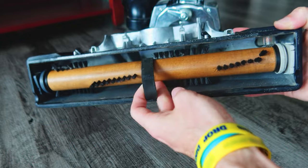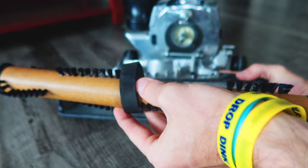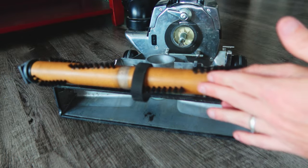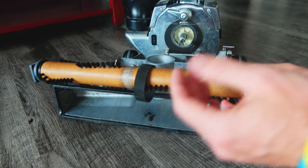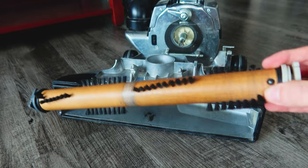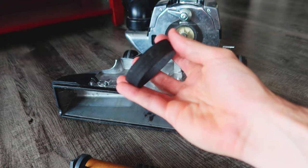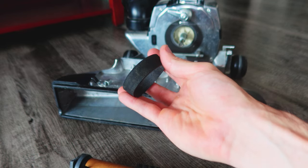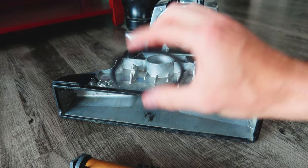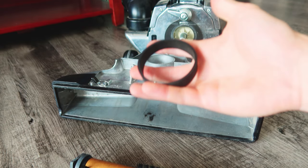Then you're going to either pull on the old belt or grab the wooden spindle and pull it towards you to release it from the vacuum head. Now is a good time to grab some scissors to clean the spindle off if you have hair, threads, or ropes stuck to it, and then pull your old belt off of the spindle. Once the spindle is clean, grab a new belt — part number Kirby 301-291. I got mine off Amazon in a pack of six for about seven dollars, and I highly recommend getting more so you have spares.